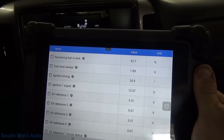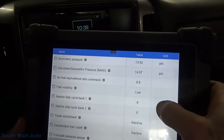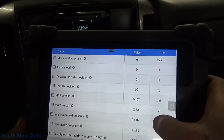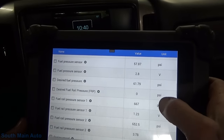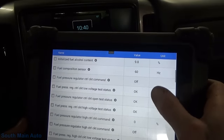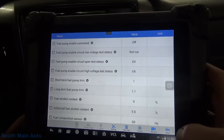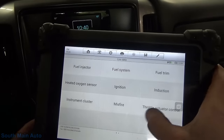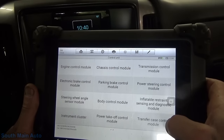So I'm curious if this is what it's looking at, because if it is, that looks fine. Let's shut the key off and see if it goes to zero - it does. Key on - battery voltage. So what we'll have to do, because I don't see anything else here. I'm seeing map sensor, throttle position. So we're making a big assumption that this is fuel pump driver data.